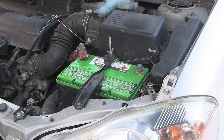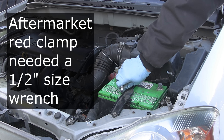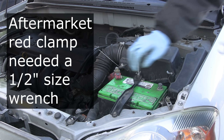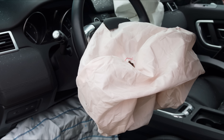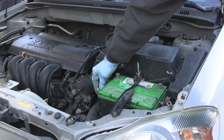If you're replacing your battery, you can disconnect the positive side without any fear of causing a short circuit. Same goes for your alternator and starter. Airbags, however, require at least a 15 minute wait or more after disconnecting the battery. Please refer to your vehicle's service manual for proper procedures.